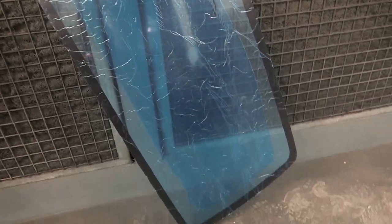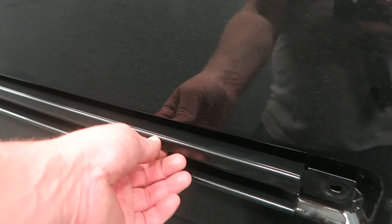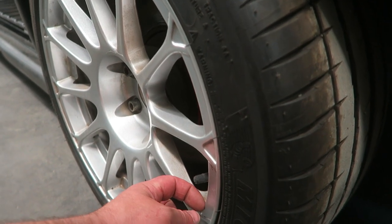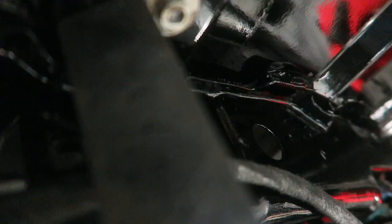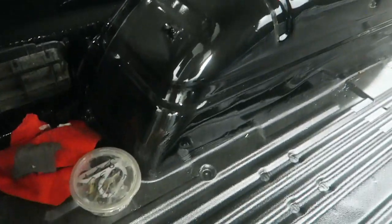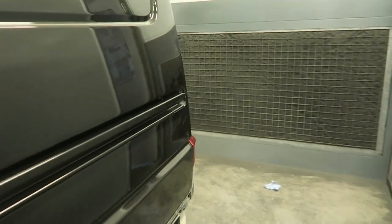So it's just a case of repeating it. You can get hardened ones — it's a lot harder for someone to break into a hardened polycarbonate window than it is to just ping the rear glass. Let's get it out of the box. It's got the protective film on, but it looks absolutely epic. Quick job while I'm putting the sliding rail on — I'm going to space it off ever so slightly, just the maximum amount of threads will allow because it catches by about two or three millimetres on this lip. You can see there's a little bit of distance there — five millimetres. I'll go five mil at the back, and once that one's in I'll measure the depth to make sure everything's even. The rail's on. You can just see a little bit of a gap over the back where the spacer is — nice and neat and tidy.